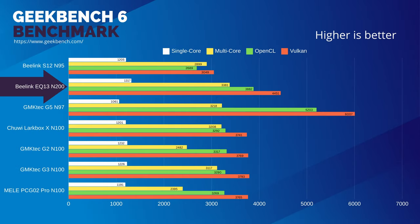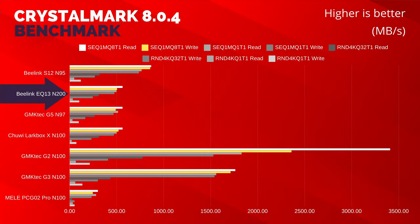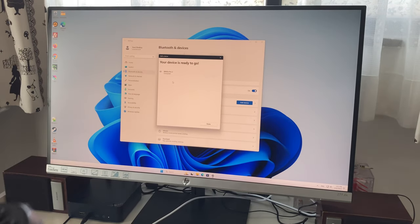Checking the benchmarks, the N200 has a nice bump in CPU performance over its peers. But as the GPU is limited to 750 MHz, graphics scores come in second behind the N97. The storage medium gave us pretty low scores, letting us know that an M.2 SATA SSD is installed rather than a PCIe NVMe. Wi-Fi signal strength is fair at around 70%, and we can easily pair a Bluetooth controller with no random disconnects from either.